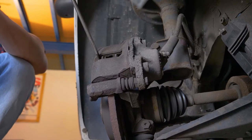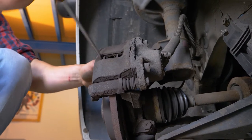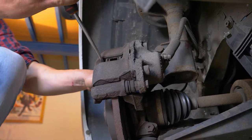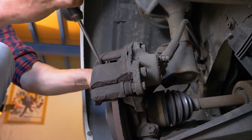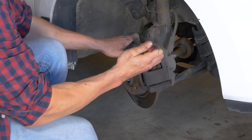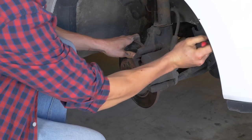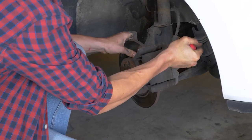Don't forget to slide the wheels under the vehicle. Turn the disc outwards — this will facilitate the process. Insert a flathead screwdriver to the outer extremity of the oblong hole located on the front of the brake caliper. Lift it off using the screwdriver as a lever by pulling it towards you. Don't hesitate to push the screwdriver further in once the space between the pad and the caliper allows. Ensure that you have pushed the piston in as far as possible before moving on to the next operation.